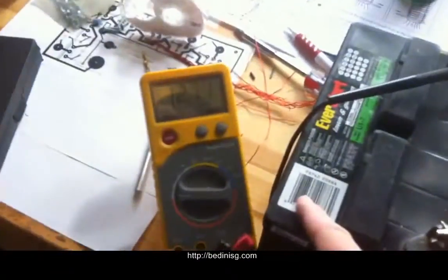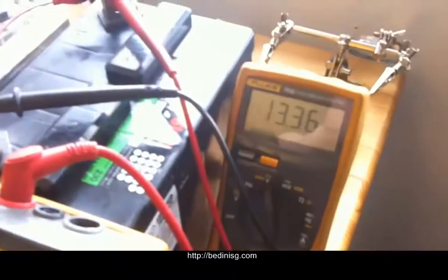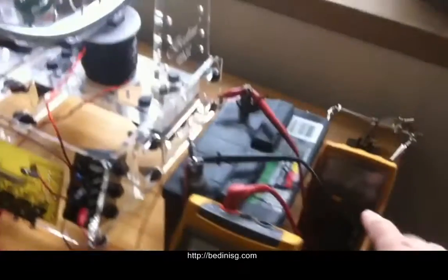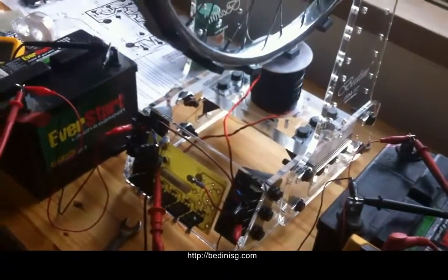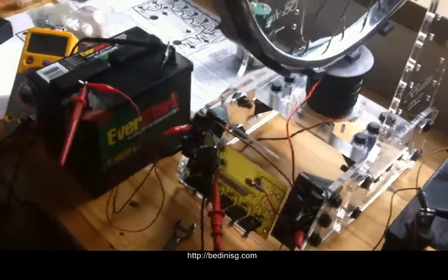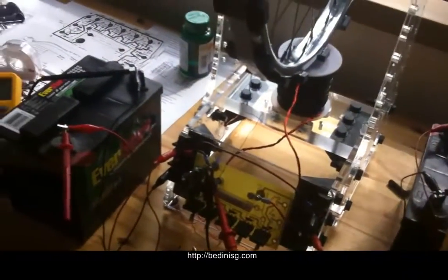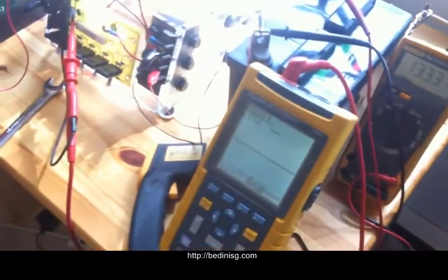This is resting at 12.71. The output recovery battery is at 13.36. A lot of people have trouble just getting the output battery up high enough — they either don't have enough punch because they don't have enough length on the wire, or maybe it's too long and they got the impedance up too high. But this is going to push it to about 15.5 fairly quick.